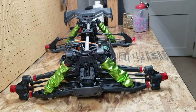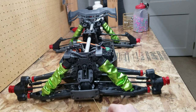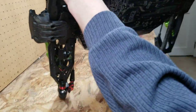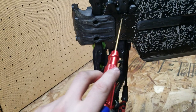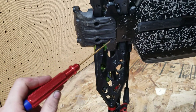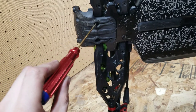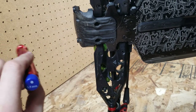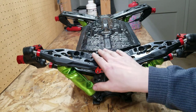First thing to do is take off the bumper — there are two 2.5mm screws here, and when you flip it over you've got 2.5mm flat taper head screws plus a 4.0mm screw. I do have a differential leak I already know about — there's fluid leaking from the front differential right there. Remove those screws and pop the bumper off, then get the skid plate off.